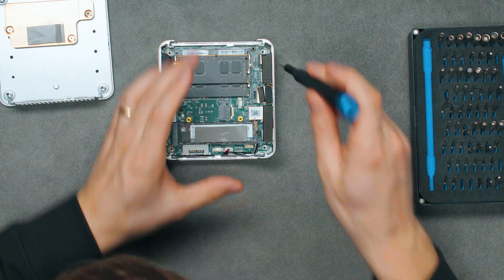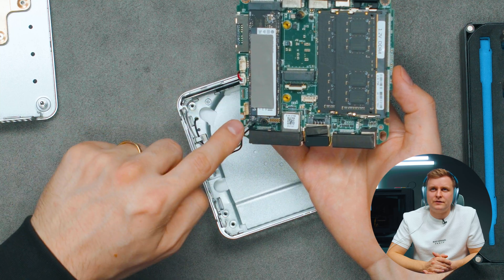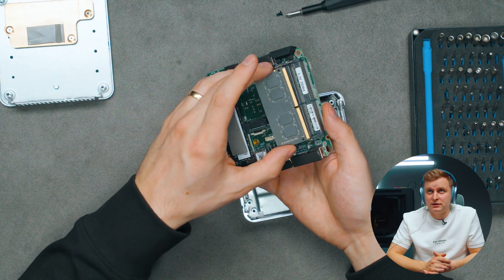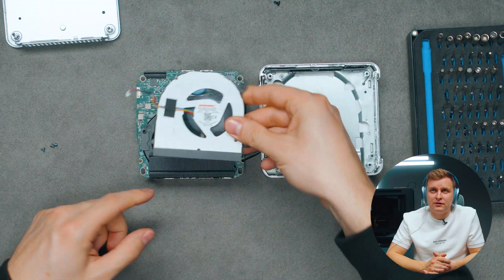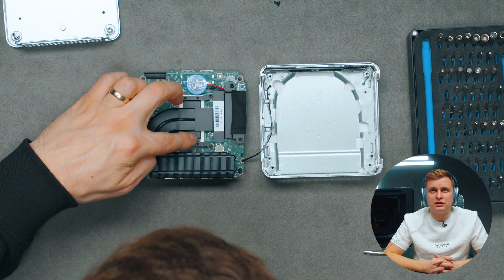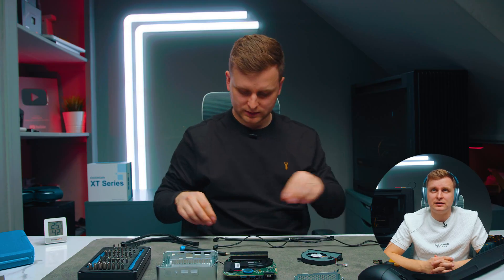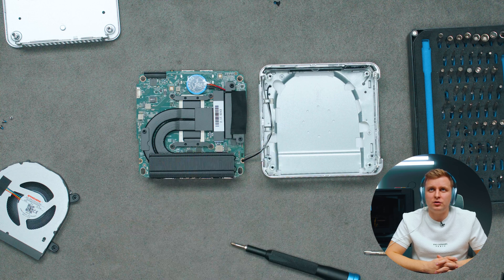After a few more screws we can see the other side. There are Wi-Fi antennas underneath the M.2 SSD and a Wi-Fi card. The heatsink is quite warm because we just used it. There's Lexar RAM as well. The glue on the heatsink has melted a little from the heat. There are two heat pipes — quite big — squished down over the CPU die. There's also some cooling on the power delivery MOSFETs and VRMs. We've got some PWM extension cables so we can actually attach a normal 120mm fan.